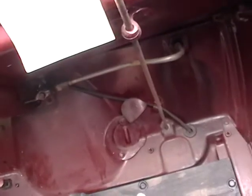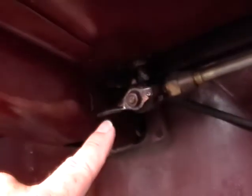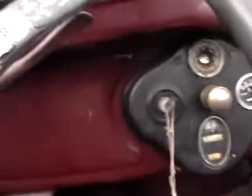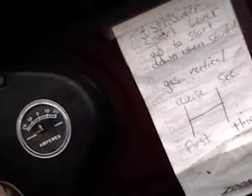The little door I was talking about is right there to let heat in. And right here is the fuel petcock — fuel is off right now, let's turn on fuel. Let's put this thing in neutral. Notice we've got this here: reverse, first, second, third is the gear pattern. This is an instrument panel light — if I just push it and turn it, it turns on; let off and it turns off.